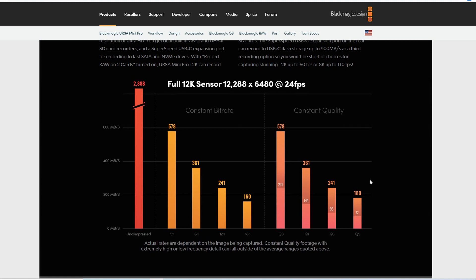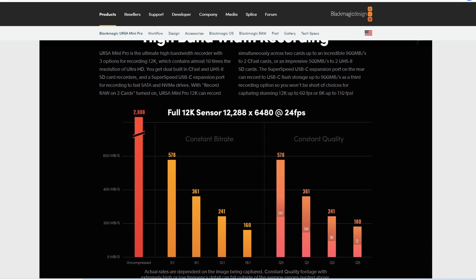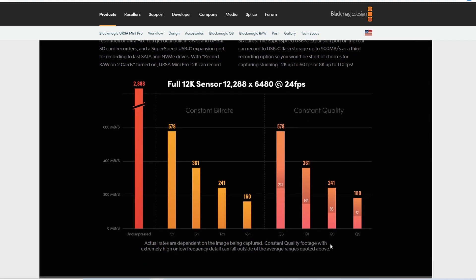The reason I talk about this stuff is just to help you out. I'm not doing this to make people feel bad or be elitist — it's just that you should be an informed consumer when it comes to buying anything like this, because your job could be on the line. I don't want to see people buy a camera capable of all this cool stuff, sell a client on it, and then walk away with nothing — shoot all day and end up with dropped frames and errors in your footage because you bought the wrong media. This camera is not out on the market yet, so you're going to have to do thorough testing of your media. CFast cards and SD cards are going to struggle with this because they're generally not that fast. SSDs will probably be the better way to go because they can reach higher speeds more easily than current CFast cards. Just keep all this in mind, and if you want to roll the dice on slower media, that's up to you — I'm just giving you my opinion based on the information available so we can be a little more informed when it comes to getting media.